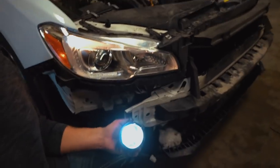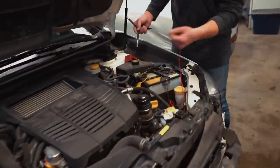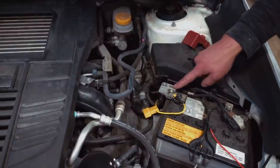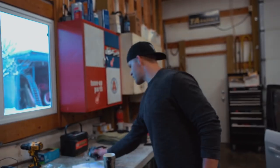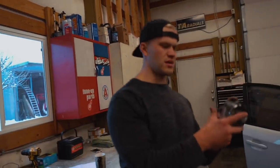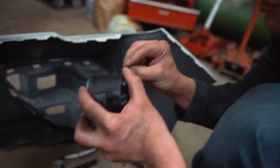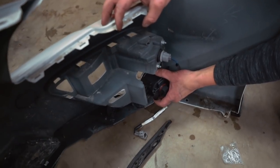The fog lights work! They're wired up just how they should be. One more step — I had the positive wire sitting on the battery, not through a fuse. There's a fused post under the hood, so I'm running this wire to that fused post — just a 10mm connection and it's done. Now I need to bolt the fog lights onto the bumper. They sent four little screws with the kit. There's a DOT-SAE marking on the fog light — that goes at the top.